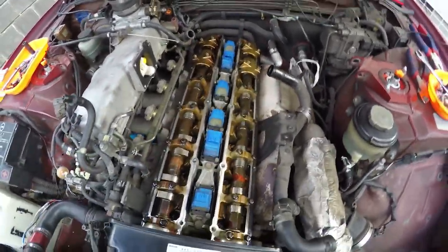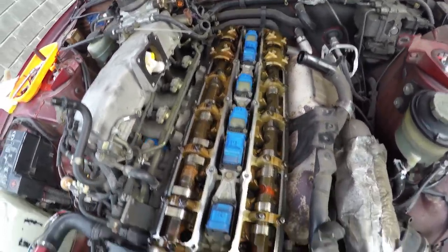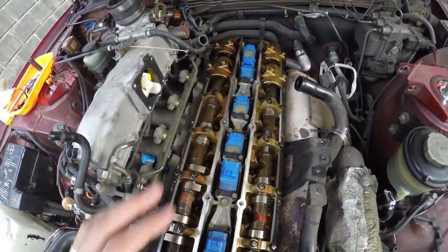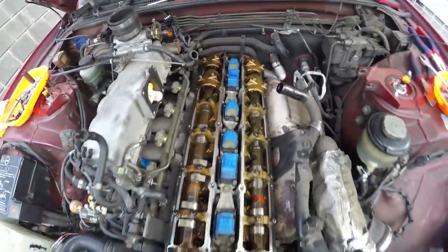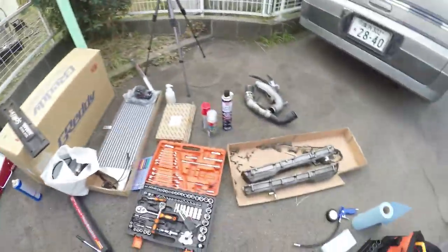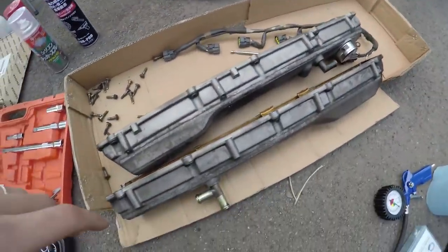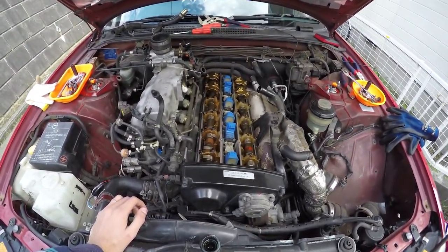So I've completely pulled off the cam covers and I am really happy with the condition of what it looks like in here. Normally when you pull these off you can get a good idea of how well the motor was looked after, and you can see that everything's nice and clean. There's no burnt oil discoloration — just normal goldy staining from the oil itself. Overall looks really nice and clean. I'm going to need a razor blade to remove some of the old RTV around here and up in the back. The cam cover's sitting down here, the seals were all old and brittle. I'm going to clean these up, cover the top so nothing blows in, then paint them and come back and finish the job.